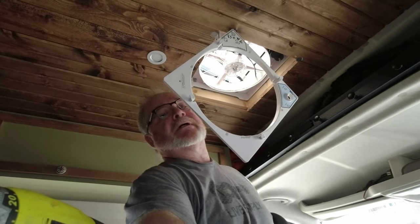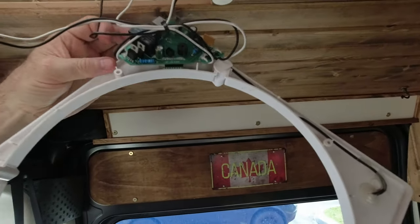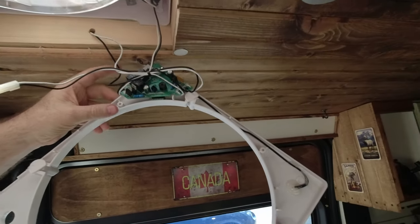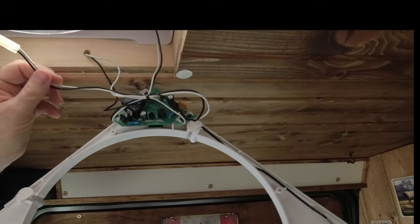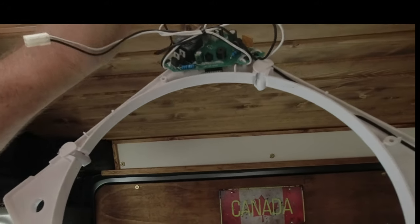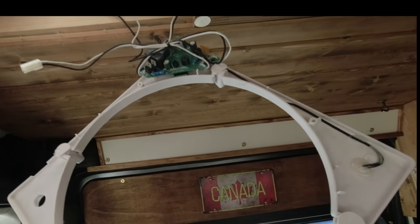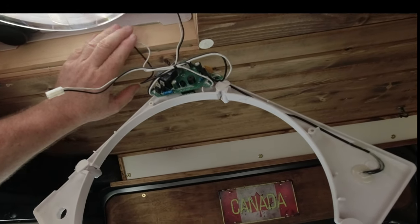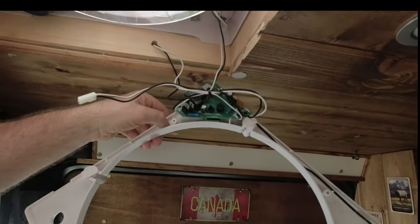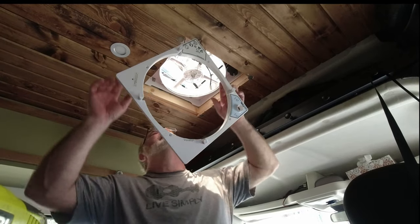Now that I've got that out, here is the computer board I have to change. I need to release these wires and take the old one out. I may have to make a joint somewhere because I think my joint was on the other side. There's a tip for you - if you're going to make a joint, make it inside the casing in case you ever have to change it. The joint should be inside this area so it's accessible at a later date, like now.